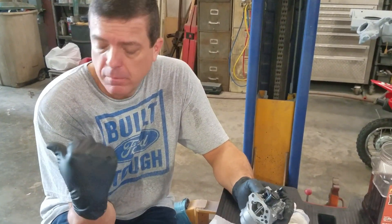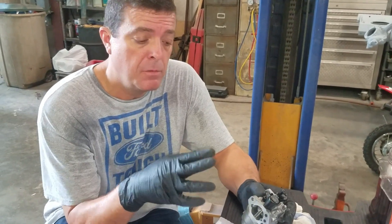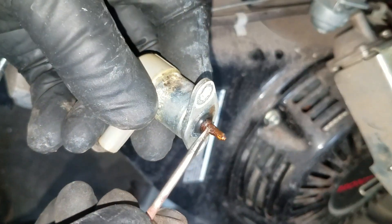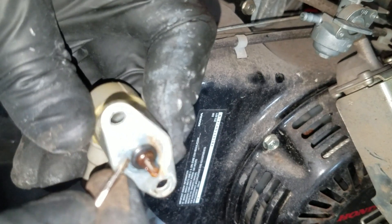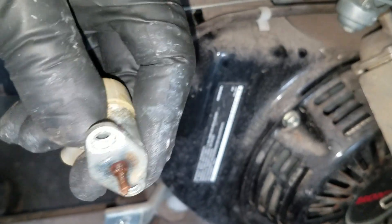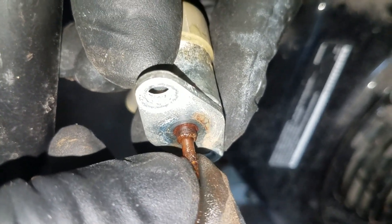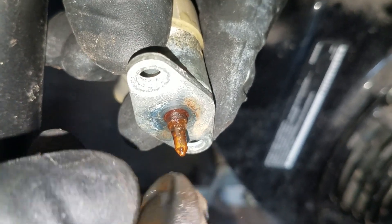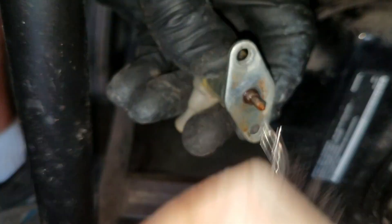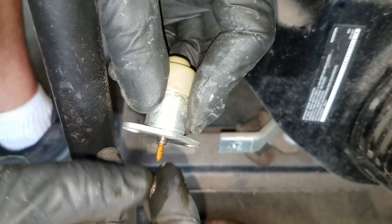The next thing is to look at our fuel stop, because it had a bunch of goop on it. If that electric plunger doesn't operate, it'll never get fuel to the carburetor. This is the fuel stop — you can see all the old fuel on it. There's a little rubber O-ring on it; we'll get that off so I can wire brush this. See how this plunger goes in and out — if it's stuck in the out position, this thing will never start, because that kills the fuel to the engine. You want it to move freely. This one actually operates good now, so I'm going to get the compressed air and blow all that old fuel out, and we'll get this carburetor put back together.